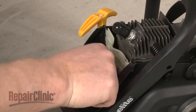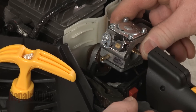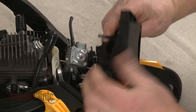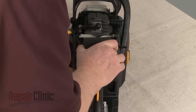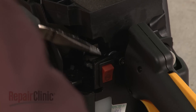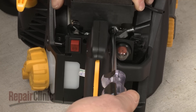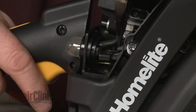Re-install or replace the carburetor by first connecting the throttle linkage to the appropriate hole in the throttle arm. Attach the fuel tank return line to the carburetor. Align the separation plate on the air filter housing and insert the right mounting bolt. Position the housing and plate on the carburetor. Fully align the assembly and thread the bolt loosely. Now insert the left mounting bolt through the bracket, slide the washer on, then thread and tighten both bolts. Reposition the choke lever and re-attach the carburetor fuel line to the primer bulb.